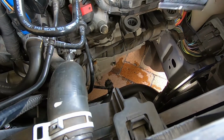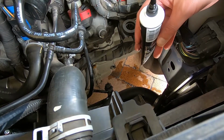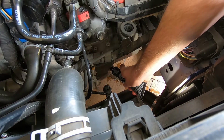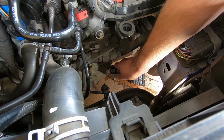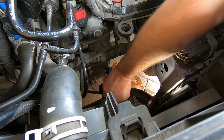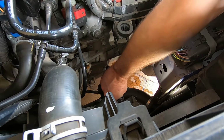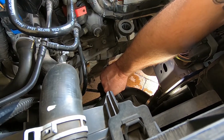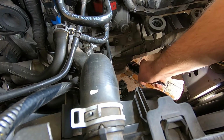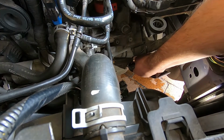In with tube 1 of the gearbox additive. Make sure if you get something like this, check if there's a foil seal underneath the tube or if you need to cut the end. So straighten the hole and squeeze, and just keep squeezing it until it feels empty. It's quite a thick, pasty thing by the feels of it. But it's going in. And in with number 2. Straight in and squeeze. Yeah, that's right.